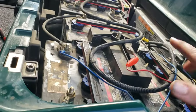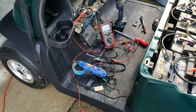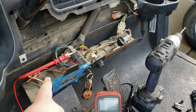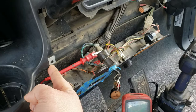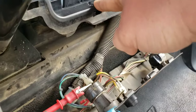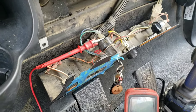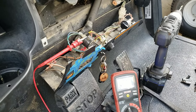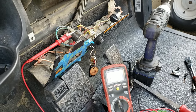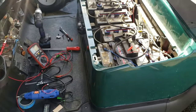Everything will work without having to run cables all the way under the cart, up through the battery compartment, and wire into anything in your batteries. To get this dash panel off, it is three screws — that's it. There are two T30 Torx drivers, one on either side, and one right up here that is a T15. Then the panel just comes down, so you can wire lights or whatever you want. For this battery capacity voltage meter, all you really need is a signal, so those two terminals should be fine.